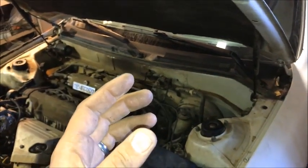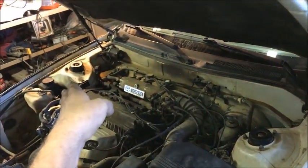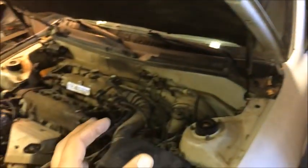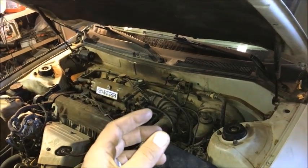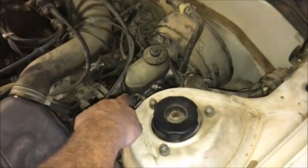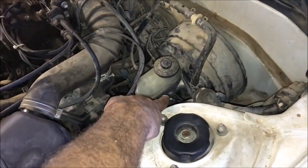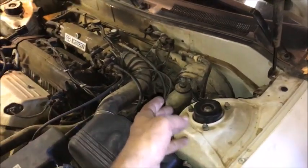In this case, the passenger's front and driver's rear had low pressure. We disconnected the line going to the caliper rather than just checking the bleeder, and the other two were fine — that tells us the master cylinder was bad. We disconnected this line here, pumped it up, and had lots of pressure. Then we disconnected this other line, pumped it up, and had no pressure coming out of the master cylinder.